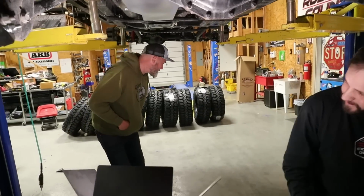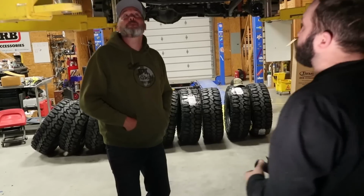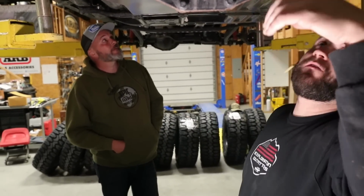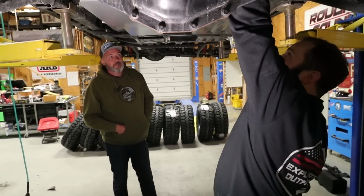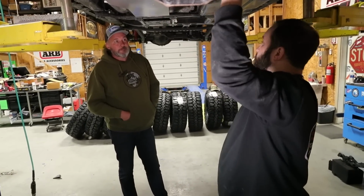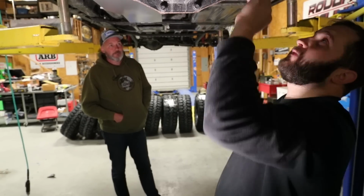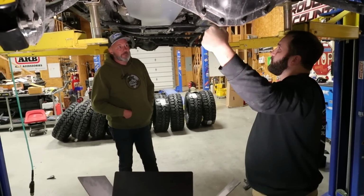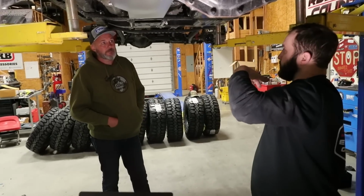How about the electronics on it? The electronics are pretty straightforward, super simple. You have a pump that'll mount here on the frame rail, and that's actually gonna pull from your filler that runs down in the tank here, and it will pump into the Y. It's already tapped with threads, so you'll pump back into the factory filler, and it's on the main tank side, so it'll flow down to the main tank.